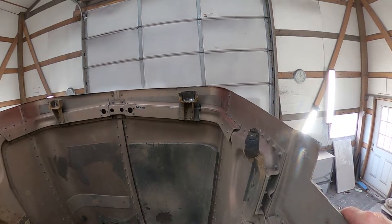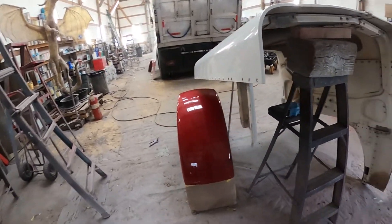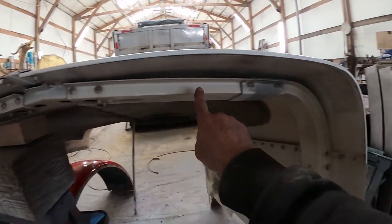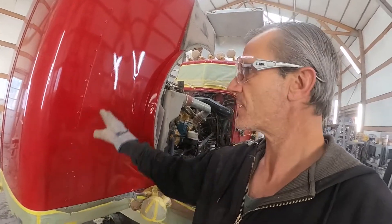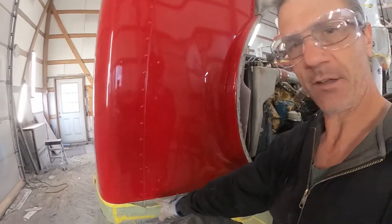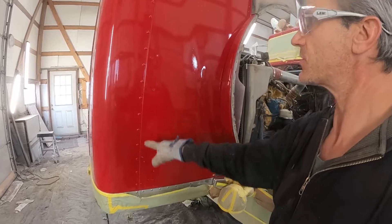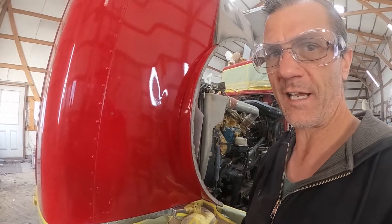Here's the other hood — I removed the fender off the truck just to get it out of the way. Now I need to remove the entire brace. I'm going to go inside and cut the back side of all these rivets so I can get the whole panel out. These are what's called huck rivets, so they're really hard on the outside — you're better off just cutting them with a cutting wheel from the other side. I'll remove this panel, get the replacement panel ready, and begin riveting it back into place.